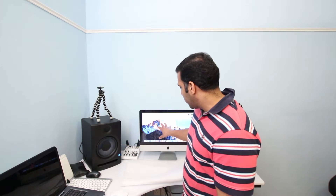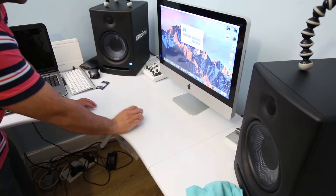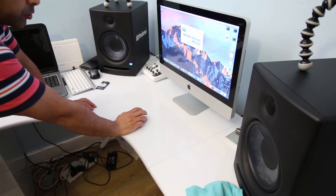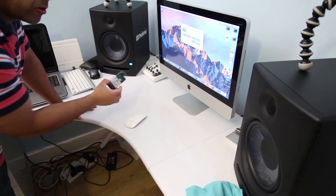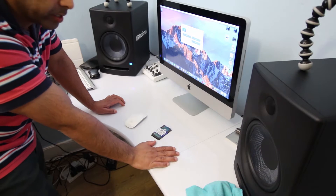The fourth slot is empty. I will install this 8GB module and show you the full procedure. Let's start — I'll zoom in on the Mac to show you how to upgrade the RAM. The first step is to shut off your Mac. Before ordering RAM, check your specifications to confirm what RAM you need. Double check before ordering.